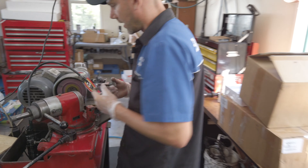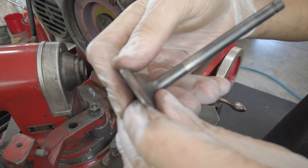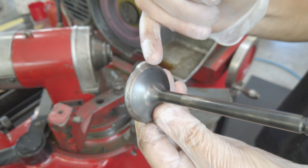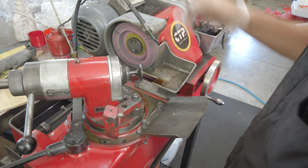So now into the valve refacer. That's the valve seat there. You can actually see on the camera where the old seat has been sitting — it's worn, just a little bit of a low spot. You've got to tidy that up. If it's going onto a new valve seat, you obviously don't want a crater where it's worn.